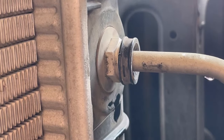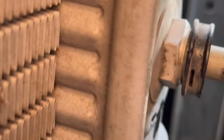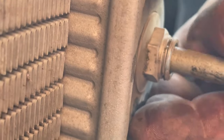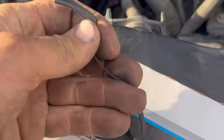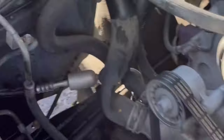The hardest part of this job is getting these transmission cooler lines off because there are some clips on there. If you lose them, you're probably going to have to get them from the dealership. First you slide this little sleeve off, then you're going to have to get a pick under there and carefully put your hand under so it doesn't fly off. I'm using 3M strip caulk — I'm going to put some of this on the underside of it so it doesn't have a tendency to fling out.